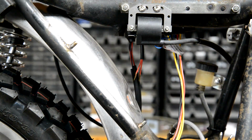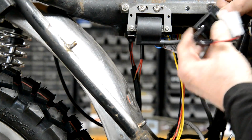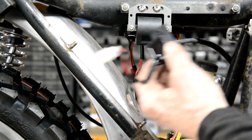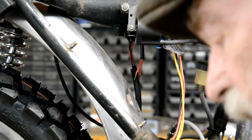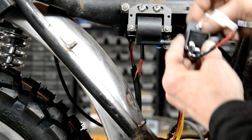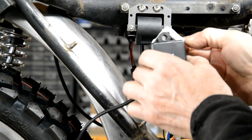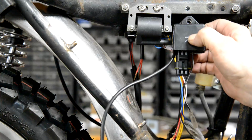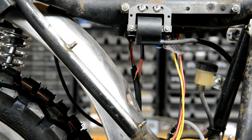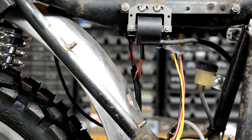this thing. And I decided, particularly with this one, I didn't like the idea of it just sort of being bolted on that piece of flat plastic. Because if it shakes, it could snap. So what I've done is I've made up a couple of little plates, right? I might even put a cable tie around each one. So there's one for that, and there's one for that. So that's not just going to be stressing the mounting there. Okay, also decided while I was getting these off that I'm going to weld the nuts for these on the back so I can just screw a bolt in.